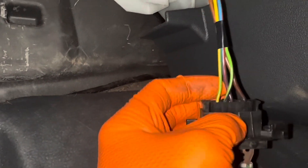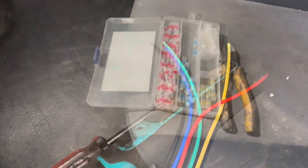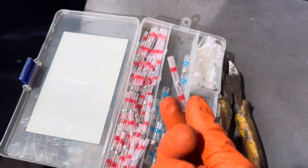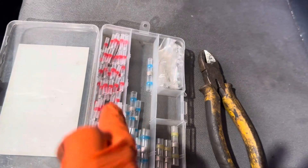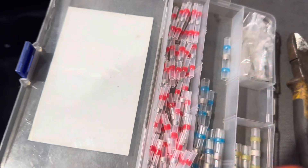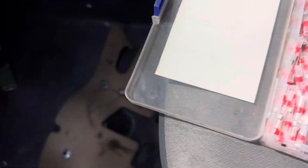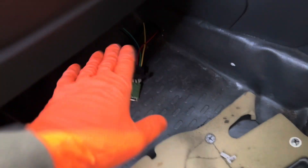The wire — you can see that second one in — is a bit burnt as well. So we'll chop them up where this tape is and then start joining them together. All we're going to be using is these soldered joins, basically a pair of snips to snip the cable. These are brilliant for this sort of thing — they're waterproof, just give it a good seal. You just use a hot air gun, put the cable in each end and heat them up and they'll solder for you. Takes a bit of the hassle out of it. Obviously being up in there where it is is a bit of a pain, but it's easier than getting a soldering iron in there.